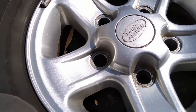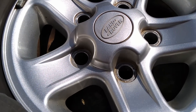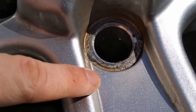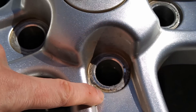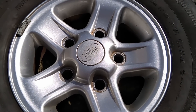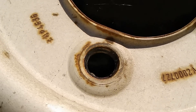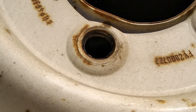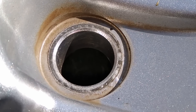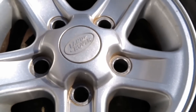The Boost alloys are alloys so they won't corrode nearly as much, but they do tend to corrode around the edges. As you can see there's a bit of corrosion happening on these, but they're in very good condition otherwise. The main difference is they're not self-centering wheel nuts, so they're a bit tricky to put on. The steel wheels are conical so they're self-centering, but the Boosts aren't - it makes it a bit trickier to put the wheel on, but they look great.